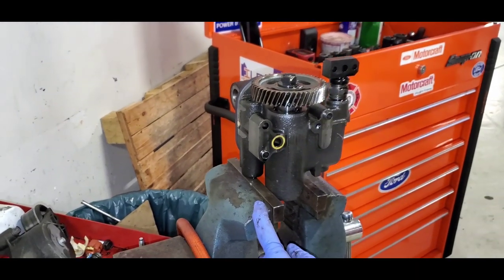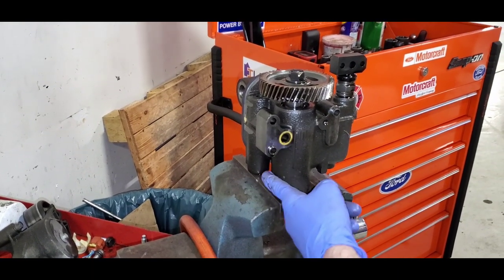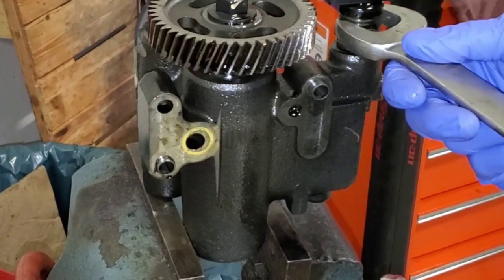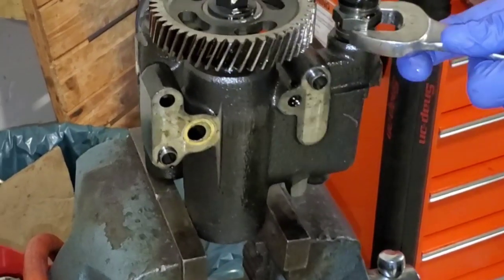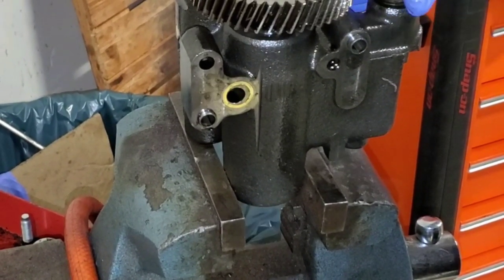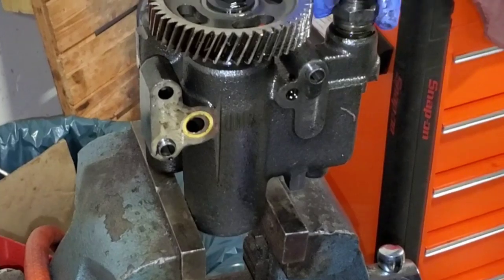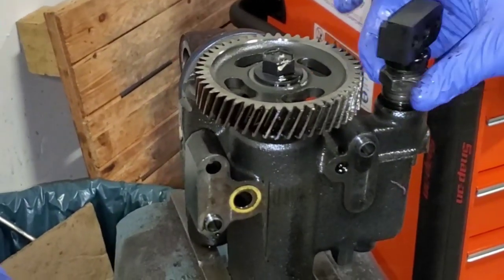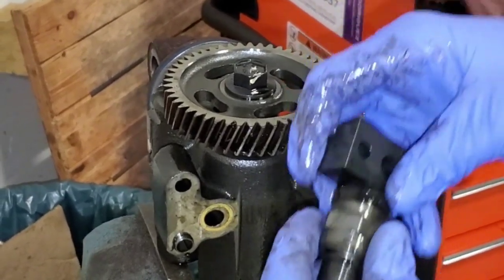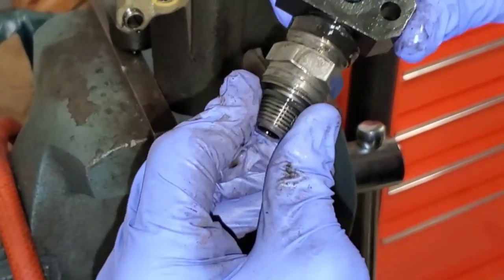I got it in the vise here and you guys can see there's a flat on the back nose of the pump. I like to put it in the vise right there. We're using a one inch — just going to go ahead and bust this out of the pump. I've had them really bad blown out, where this piece just comes right out of the snap-to-connect fitting without even doing anything. It's supposed to be a special tool to separate these two, but like I said, they come apart. You can see there's a little play in there — potential high pressure oil leak.